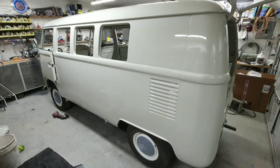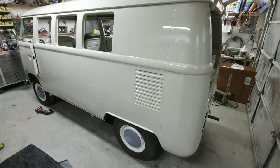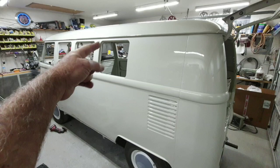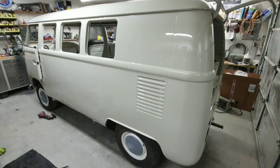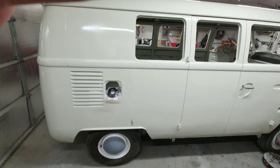Like I said, the color sand and buff is going to do a little bit more of the work this time. It's funny how many cars I've shot where I got no orange peel, like my daughter's 90s Honda and my other daughter's car. I laid it down perfect because you're not spraying a vertical flat panel and around all these windows, trying to get all the angles. I still get dry spots and things like that in there. I don't usually get that, but I was just snowblind out there. I couldn't even see it. I was walking around afterwards looking for flaws and didn't see them out there, but I pulled in here and went, whoa, what happened? Where did that come from? So different lighting and different things come into play.